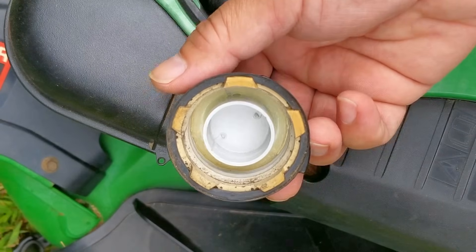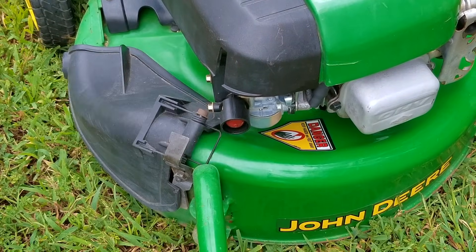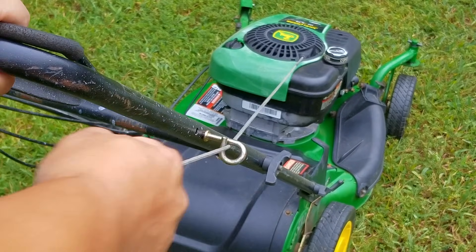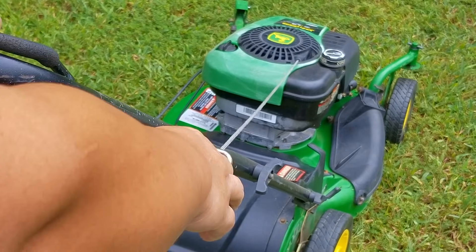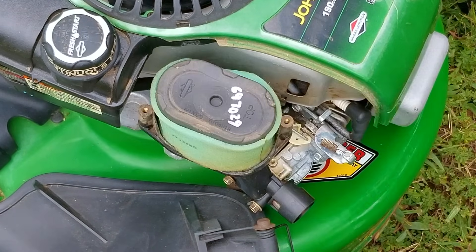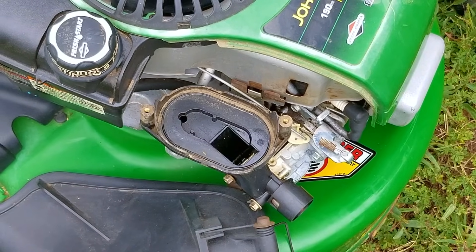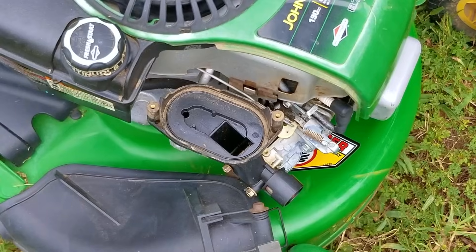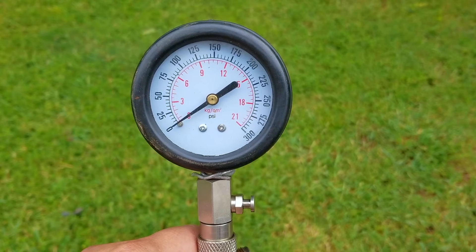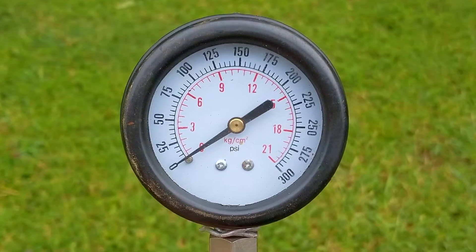At this point, I want to try and start the mower and see if that might give us a clue as to what the problem is. As you just saw, it didn't even try and do anything, which is not a good sign. Now to rule out that our problem is related to the fuel system, I'm going to add some fuel to the carb and then try starting it again. This time it started and ran for a good bit of time on the gasoline I put into the carb. That means we won't need to use the compression tester because the engine starting and running tells us we have plenty of compression.